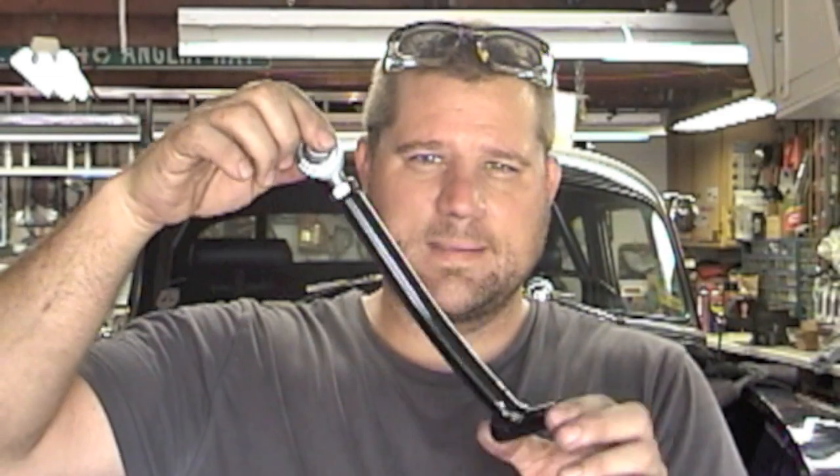Now I'm going to install my torque limiter bar — I bought it as a kit and modified it to work for my setup. If you're running motor plates, you really should have one of these. When you're on and off the gas, your motor plates flex, and you need something to keep the motor solid to the frame. This is Chassis Engineering's weld-up kit — I had to put a slight bend in it to clear my steering knuckle.